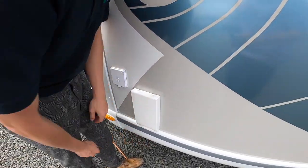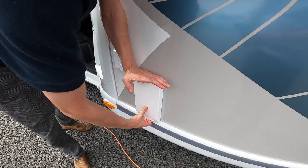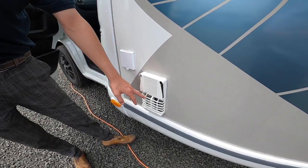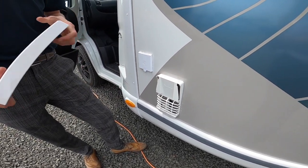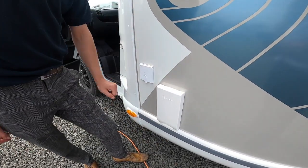If you're heating your water on gas, this cover must come off — hand on the top, thumb in the middle and peel it off. It just allows the fumes out; otherwise the heater will fail as the fumes can't come out the flue. When heating the water on electric or when travelling, this can stay on.